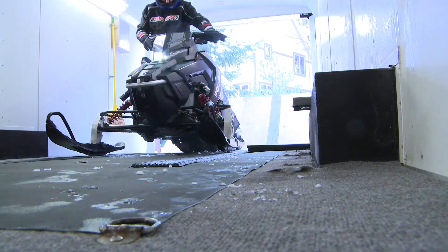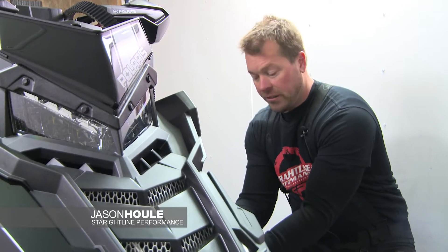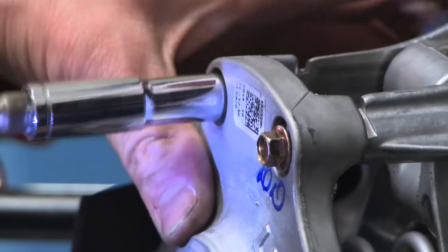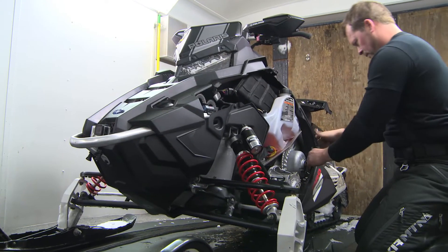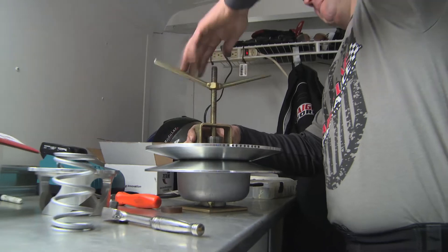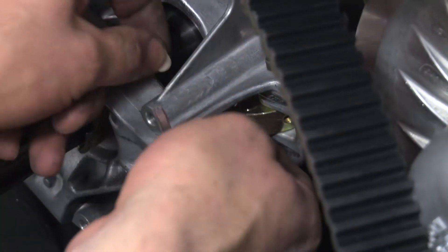We have just got off the lake making some changes to the new Polaris — changing a set of weights, making a new set adjustment on the secondary spring and helix — and we'll be back out in the field to retry it again. Tuning like this is an all-day, if not two or three-day project. It's not something that's going to be done in a day. Each machine takes hours and hours of in-field testing to confirm all the previous data that you've seen in the shop.